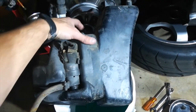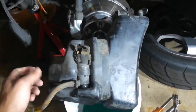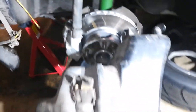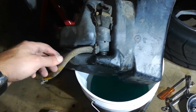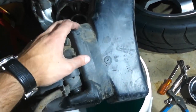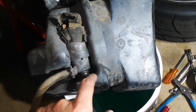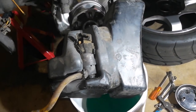Here's another view of the tank — looking at the side view, this curved part obviously goes against the wheel. This part faces forward. It's got a really weird shape to fit up in this corner of the front of the car. That big clamp I had to release from the bottom goes over this narrow portion here, and tucked away is the pump. While I was moving the tank around trying to get it out, I think I disturbed the rubber seal between the pump and the tank and it started dribbling a little. I'm hoping it's just a seal I disturbed and not a crack in the plastic tank somewhere — we'll check that out later.